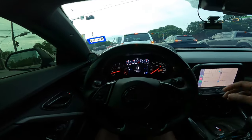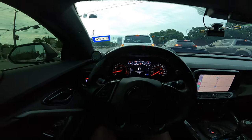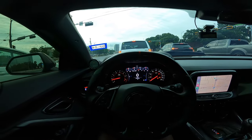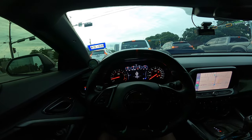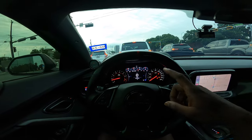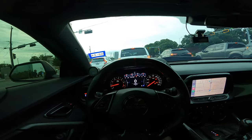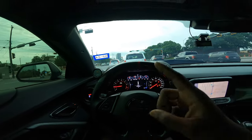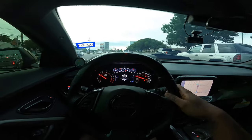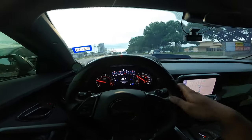I might try to do a pull and we'll see what happens, but it feels weird — the car doesn't feel happy right now. The gauge is disconnected and I really think it's just a loose ground. Actually, now that I think about it, it's got to be the power wire, because the grounds are at two separate locations — the ground for the stars is in the back and the ground for the AFR is on the manifold in the engine bay. The power wire is the only thing they share, so it's probably just a loose power wire.